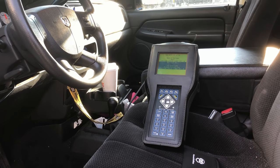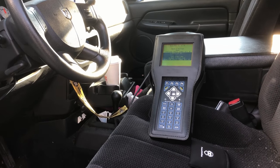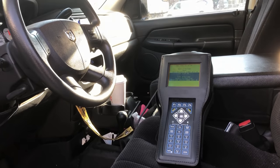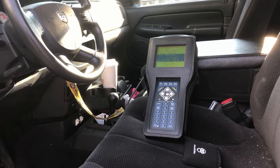These vehicles — this is a pretty early model, this is a 2004 — use a front control module with an integrated power module attached to it. The integrated power module is the fuse block. The front control module bolts to it, and that's what controls most of the lighting, horns, and wiper functions.